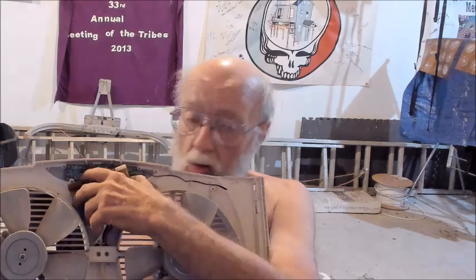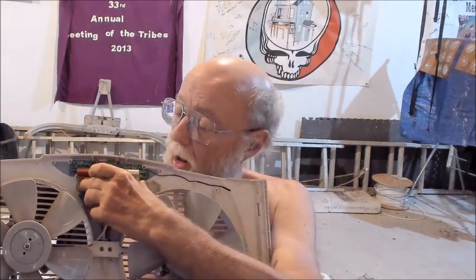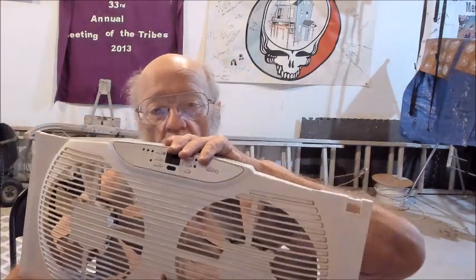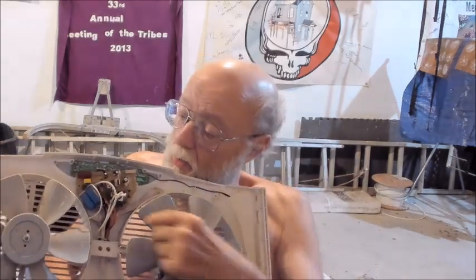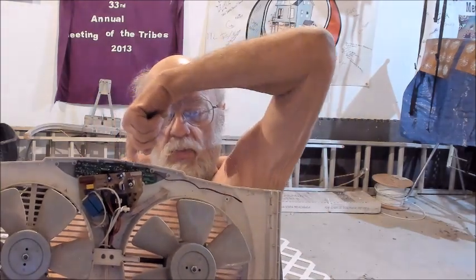The control board here, and then you have this board. Okay, you get 120 volts in. The control board and this stuff on the front doesn't run at 120 volts. Normally, computer logic could be 3 volts, 5 volts, 9 volts, DC, direct current, not alternating current like you get out of your plug. So on this board, there are actually three major sections. The first is converting 120 volts AC to some voltage, maybe 5, 7, 9, direct current, that powers this front panel button control board up front.